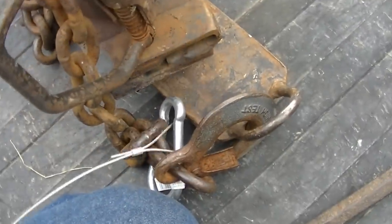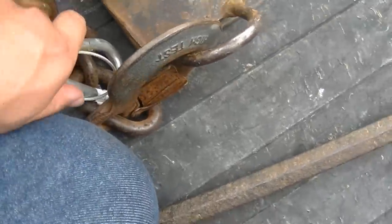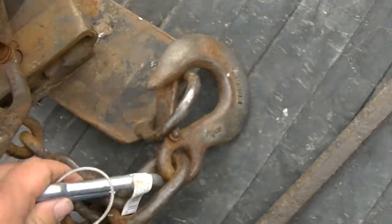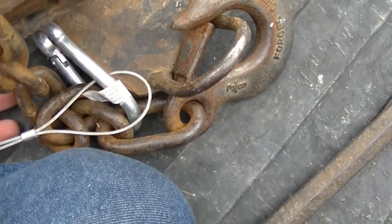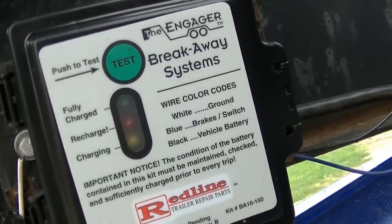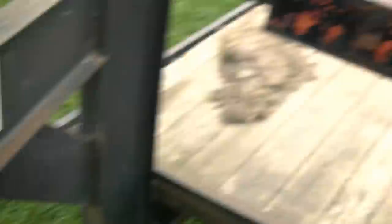The next thing you want to do is hook up the actual brake controller itself. Here we have it hooked onto the chain. You can unhook it and find a place on the truck so that if this whole system fails — say the pin underneath the fifth wheel comes out — this will catch and pull out a pin, just like I just did. What that does is relay back to the brake controller, and when that pin pulls out, the trailer will automatically start locking its brakes. This is a safety system to make sure you don't have any rollaway trailers.